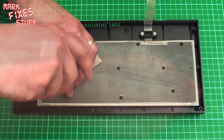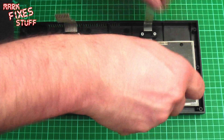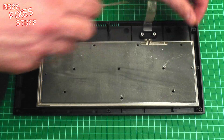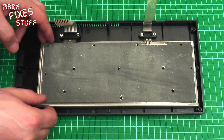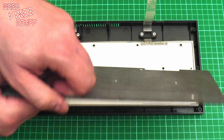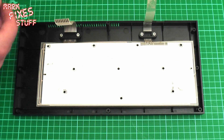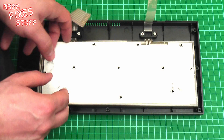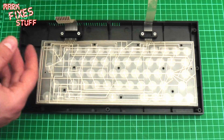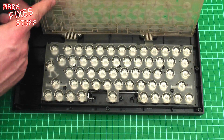You'll lose a couple of minutes here but you won't have to watch me doing all of that. It's like being abducted by aliens! Last couple of screws coming out now. And we can take off this huge lump of metal which, if you weighed it in, is probably worth more than the Spectrum - probably lead, so I'm probably going to go blind now. Okay, now there's a plastic shield. These seem to be different in every single Spectrum Plus that you open up - they can be thick plastic, thin plastic, some feel papery. And underneath that you've got the membrane itself. This is utterly useless - it's all cracked and old.